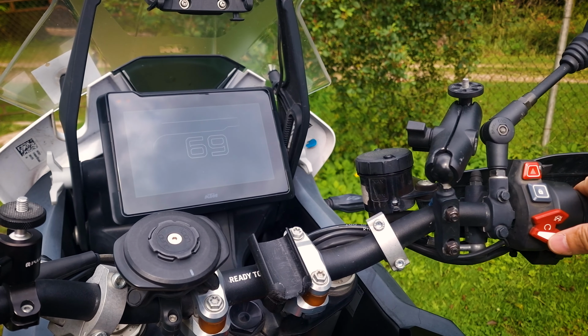Since I removed the plastic, I got access to the plugs. And the next thing I decided to check was spark. There was no spark. And the cause of that could be the crankshaft position sensor. The crankshaft position sensor is the only sensor on a motorcycle, like in a car, that determines whether or not there's spark. And the whole computer is based on it as the main sensor. And this sensor is not duplicated by anything. So if that sensor fails, the bike won't start.